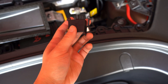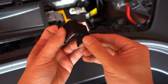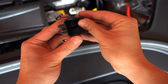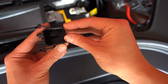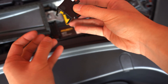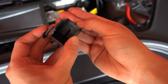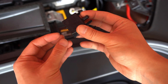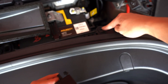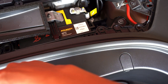Now that we've got that thing released, let's see what's wrong with this. Right now it's broken — you might not be able to tell, but there's meant to be another piece down here. You can see there are three really small legs: one here, one on this side, and one on this side. This is broken. There's supposed to be a third piece held by these three little legs, and it's a bit smaller than the top piece. As you apply force down, the three legs just snap and that small piece basically goes inside. Mine is just broken completely and that piece is just gone — maybe dropped down there, maybe somewhere on the road. So this piece here is no longer being reinforced across that metal bar. I'm going to do the same thing on the other side.